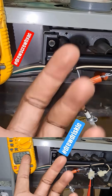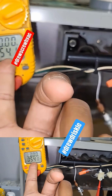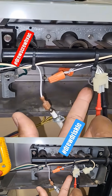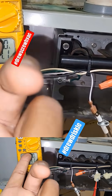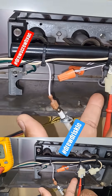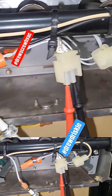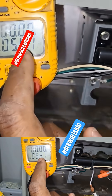If your igniter ohms out of range — for instance, if the range calls for a maximum of 50 ohms and you're getting 54 — even if the igniter is still working, you should bring this to the customer's attention. An ohm reading outside of range is a good indicator that the igniter is probably on its way out, and to avoid breakdowns, it's highly recommended that you recommend replacing the igniter.